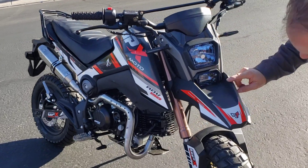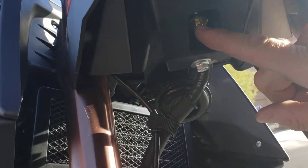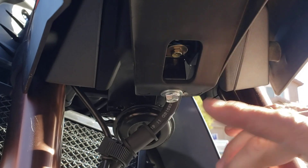If my cameraman can get under here, there's a little bracket right here that we forgot to mention in a previous video. It's kind of a little bent L-type looking bracket — you'll see it in your package. That goes here. The headlight adjuster connects to here, goes down, and then you screw it in. It has a nut that's welded to the back of it, so that goes there.